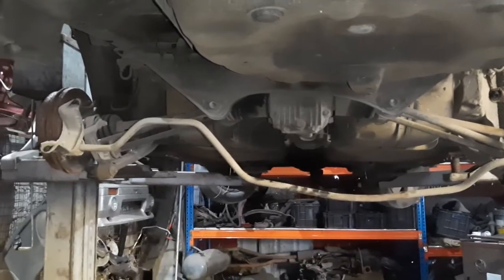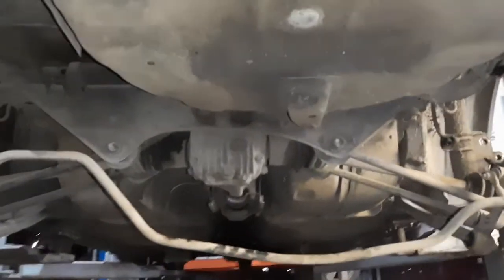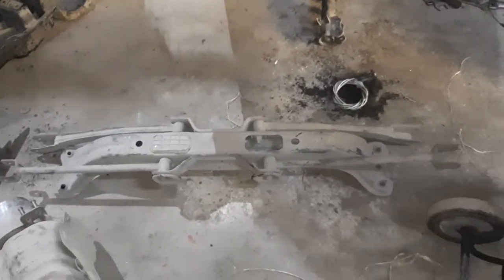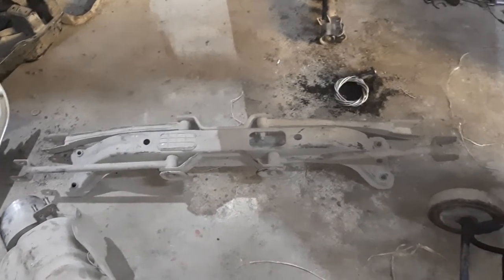If you take a look at the rear suspension assemblies of the Subaru and the Hyundai, practically it's the same suspension design. McPherson strut, dual parallel lower links on the bottom, and a trailing arm in the front. They kind of interchange. Of course, the mounting holes on the top of the subframe are different, but you could almost make it work. Just a little bit of fettling and you can get the Subaru rear suspension to sort of bolt on to the chassis of the Tiburon.